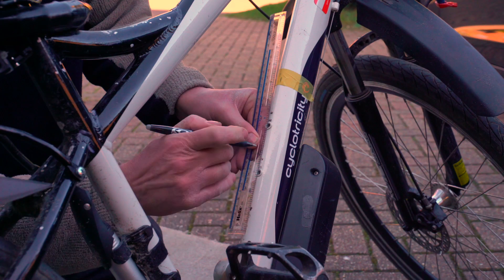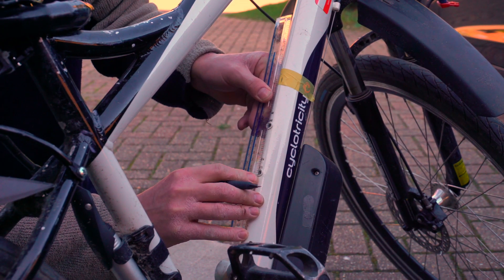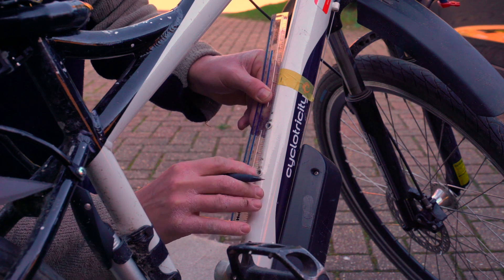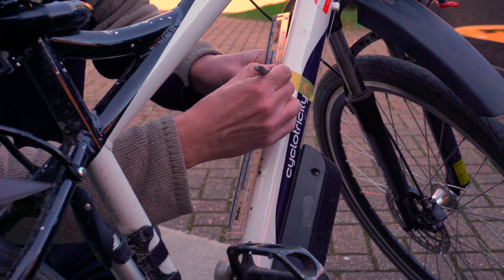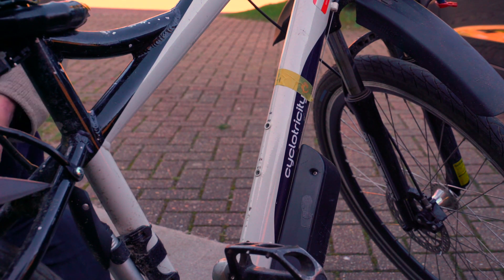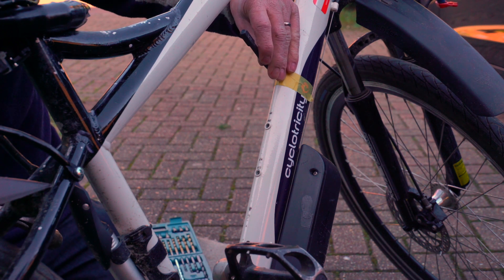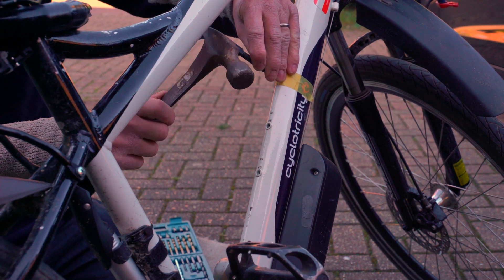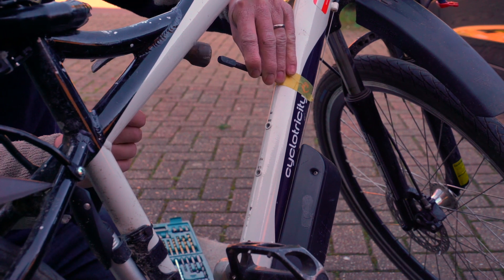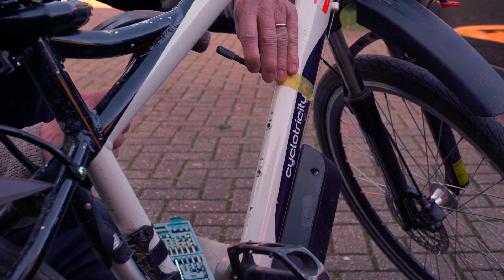Because of the design of this bike it's quite easy to measure where the hole goes sideways. But here's another bike I've been working on, and as you can see in this instance it's very difficult to measure where the hole goes. The answer is to use a ruler — line it up with the existing holes already in the frame, and that means your new hole will be in alignment too. Once I mark the hole, I use a center punch to mark where the hole needs to be drilled. There's an added challenge that you've got a small space to work with in the frame, so I had to come in from one side.